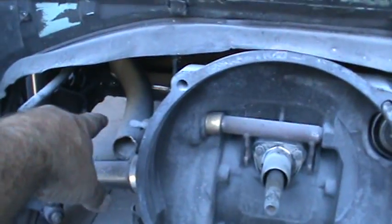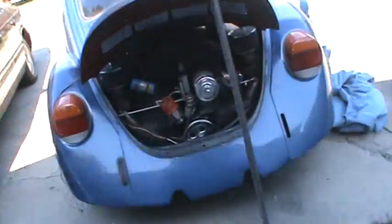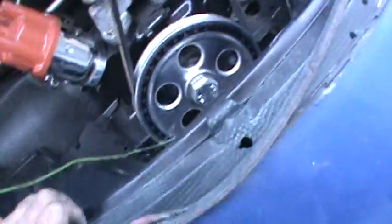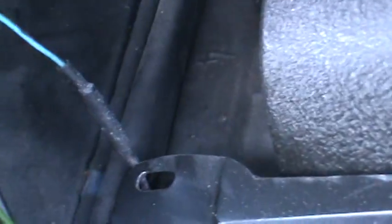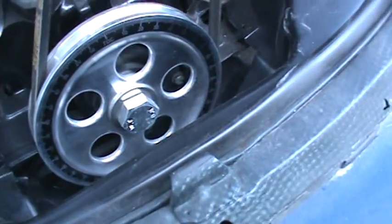What happens with the doghouse cooler is it blows the hot air out the back of the fan housing through a little chute. When you don't have these seals in place — especially this seal — and you get holes, this one needs to be replaced anyway. The pan sits against the seal and keeps exhaust from coming back up into the engine compartment. On this car with a new seal, you can see how tight it is — it's airtight, and that's how it needs to be.